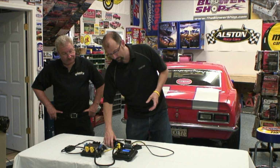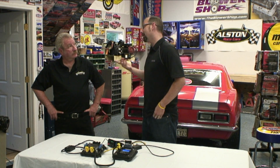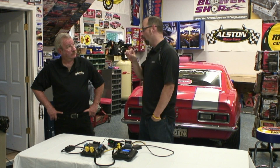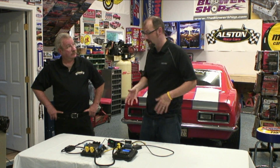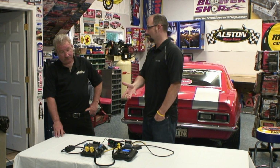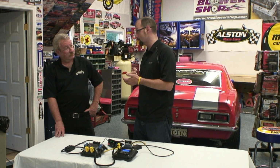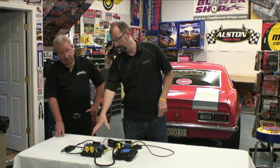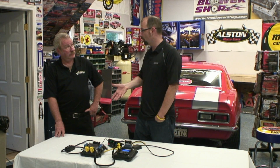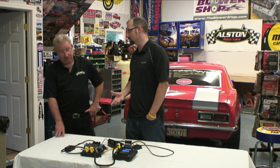A lot of guys look at it and say, I'm using 70 amp relays for my nitrous, so 70 amp relays have to be bad. A lot of guys have come to us and said, show me a 70 amp relay. I don't need to show you a 70 amp relay. I can show you 2 170 amp MOSFETs in parallel. This is designed to handle the current. As big of a solenoid as you want to put, we can control right off the MOSFET. The nice thing is there's no mechanical contact. You're not worrying about burning relays out, especially when you're doing progressive and cycling the solenoids on and off. That's all built in here. So the same rock solid technology we use to control the base functions in the car, we've now tacked onto that to get you very powerful control of your nitrous system.